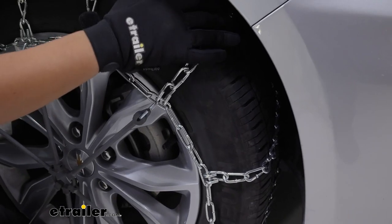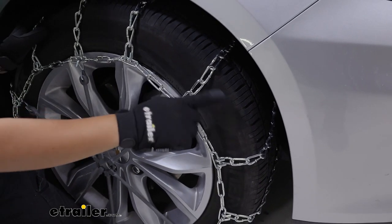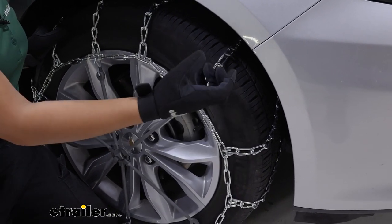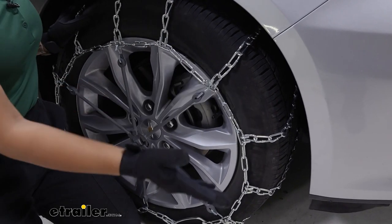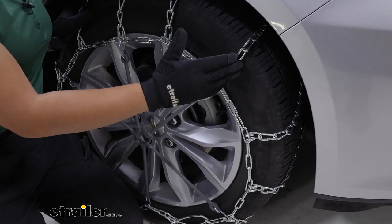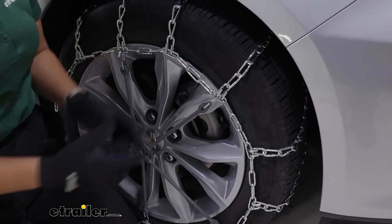They are shaped as twist links, which is great for snow or even mud because the chain just rolls through and doesn't pack up as much compared to other grippier style chains. Now if you're expecting just a little bit of ice, this will still work out. But if you're expecting a lot of ice, you want something with more flat edges.